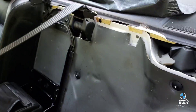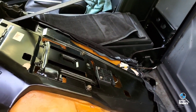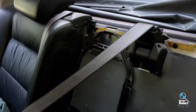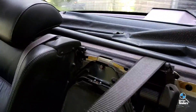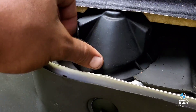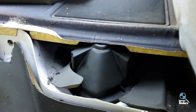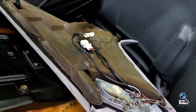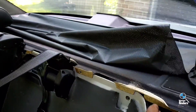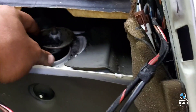I got the seat back lowered. To remove it, pull out the rear headrests — in that channel you have access to a 10mm bolt holding it on. Then take a 10mm out of the middle headrest area, which gives you access to another 10mm holding that on. Once you pull the seat cooler out, you have almost immediate access to the shock tower where the problem is. You just pull the parcel shelf forward and unplug the two wires — you don't have to take it all the way out.